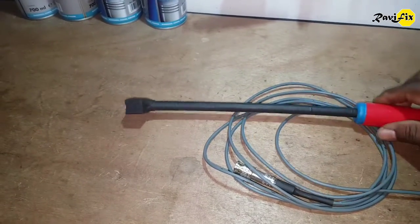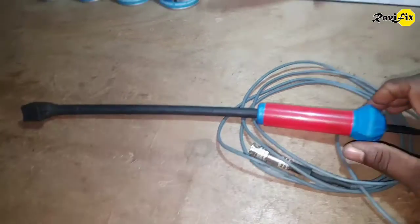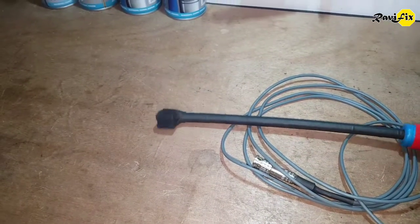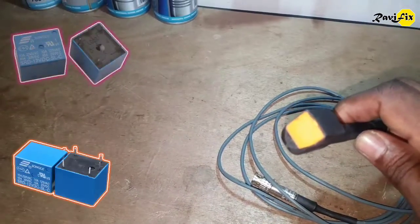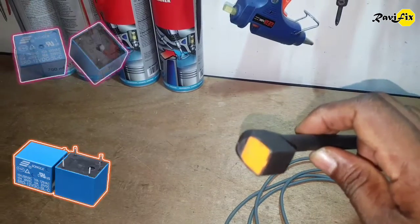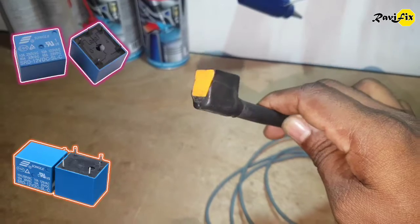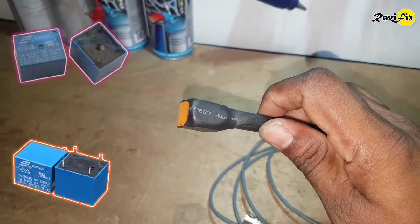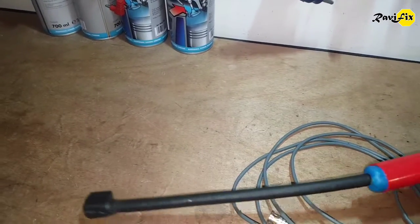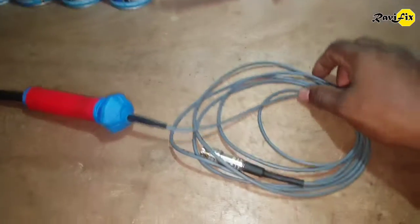Here I am going to briefly explain how you can make this probe yourself. First, I'll tell you what I used as the inductive pickup point of this panel probe. I simply used a 12V tiny relay, the kind used in electronic projects. I know this is not a new concept — using relays to make DIY secondary ignition probes — but I tried to make a handy probe with these tiny relays. I also used a broken toy arm as a recycled material for the probe handle.